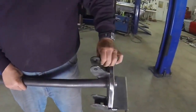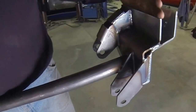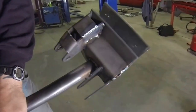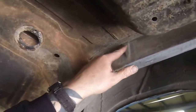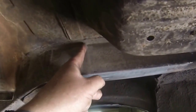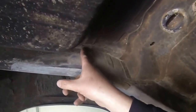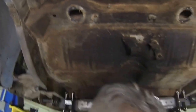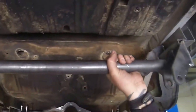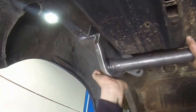We're going to put in the upper shock mount — here it is. This right here is for the panhard bar; that goes on the passenger side. This thing will only go one way because these are canted on both sides. If you look up here, you see this little body indentation — that's where the edge of your upper shock mount goes. There's one on each side. It goes right up against that, so I'm gonna get Ron in here to help and we'll set this bad boy up in here. This baby is gonna fit tight — that's the way we made it.